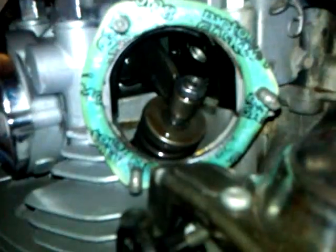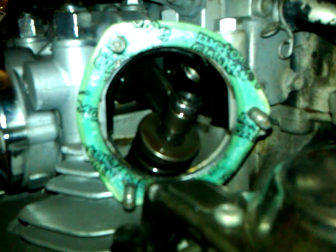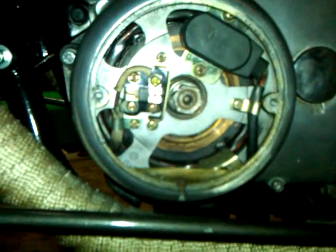This is exactly how I do it — my first step. I've got my 17 millimeter nut turning counterclockwise on my rotor, and I'm going to turn it and watch the intake valve start opening. This is stroke one — the piston's going down, sucking in the air and fuel mixture into the cylinder. You can see it going down, and now it's starting to come up. Once it stops going up, you want to stop turning.